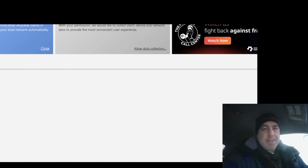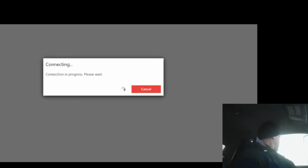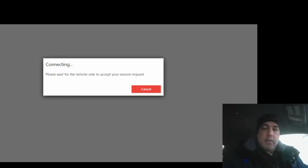Okay, so the fuel rails have been fixed on this car, supposedly. I mean, they changed the dampers out, so we'll see if taking the dampers out fixes those weird fueling trends. And I think you can still... Nope, not yet. Let me fix that for you. And you'll be able to see it on the dyno graph how the air fuel is going up and down, and that's super indicative of the dampers on a turbo car.